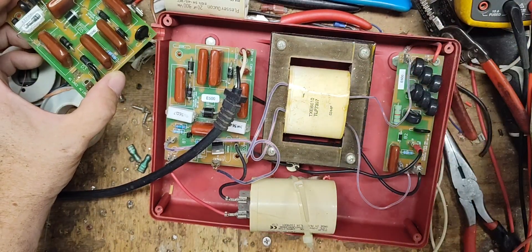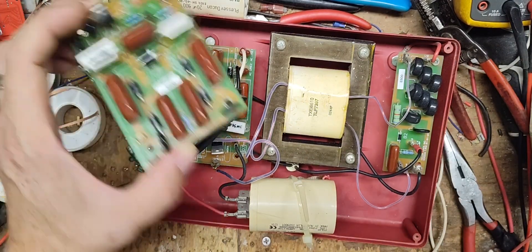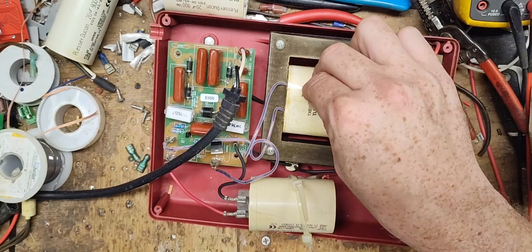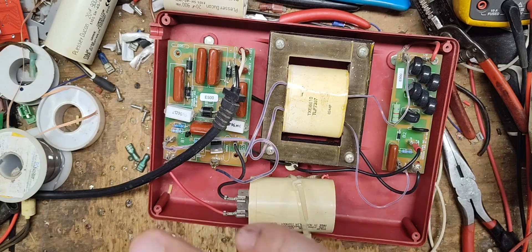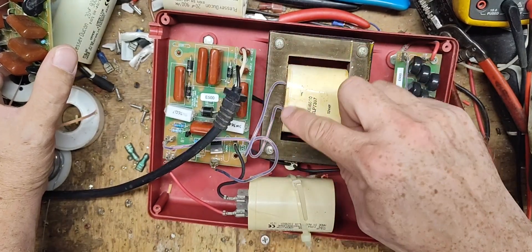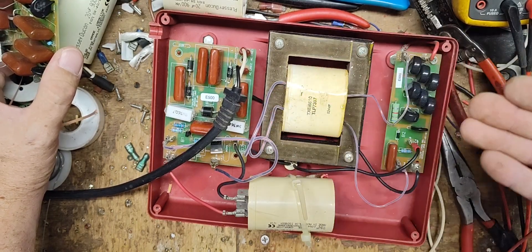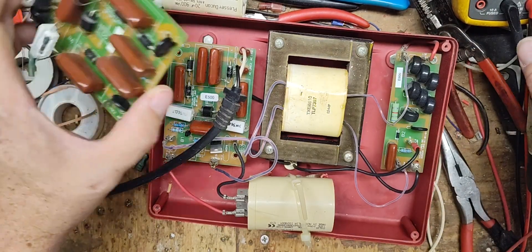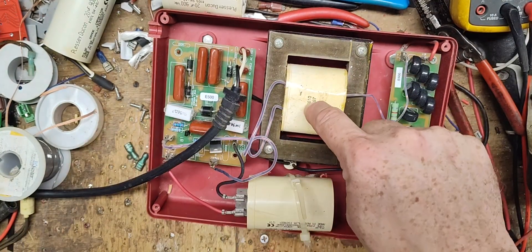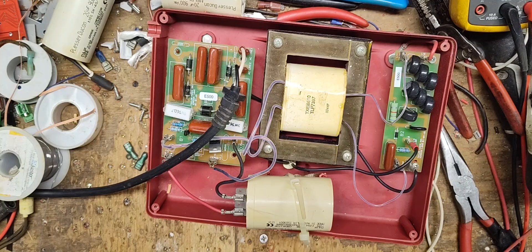The transformer boosts the power up and spikes the voltage to a high-voltage DC, low-amperage output. So it takes roughly 600 to 800 volts DC in and the transformer converts that to 6,000 to 10,000 volts DC out every time it clicks. The clicking noise itself comes from the transformer - when you hear a unit click and fire, that click is the transformer, not the board, not the capacitor, no relay, no solenoid. When that energy from the capacitor is discharged into the transformer's input side and it spikes it across to the output side, that spiking is the click noise. People always think it's the capacitor discharging, but that's not making the noise - it's the transformer doing its job, on all models.